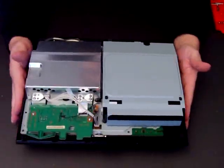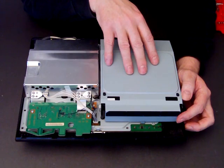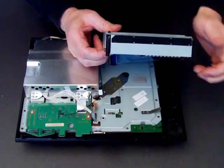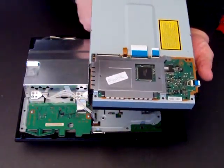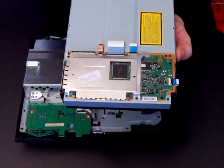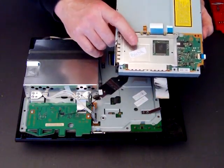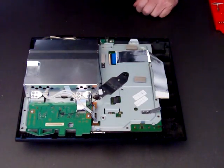Now what you need to do is remove the Blu-ray drive. We do that by simply lifting it and removing the power cable, and lifting it further — underneath there's a little clip that disengages the data ribbon. On the bottom of your Blu-ray there's a little circuit board called the logic board, and it's matched or paired with the motherboard — they can't be separated. So when you buy a motherboard from the site, you'll also get the paired logic board, so you'll need to change both. But for the moment we'll get on with removing the motherboard from the console case.